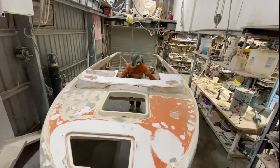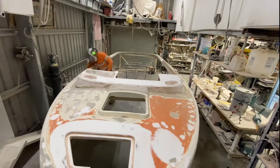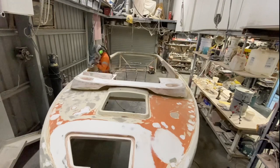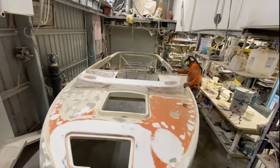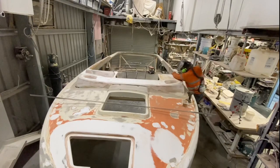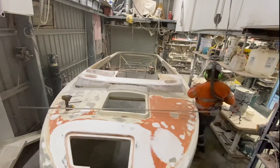It's pretty easy to get it lined up because it's such a snug fit — there's four areas where the dash leans against, and that's where the screws that I did last time. After doing the dummy fit, I found that I needed to grind down the little tabs, the little extensions that I was working on before. I have to do that a few times to get it to sit right. The old holes are still in it from where I tacked it together with screws last time I glued it, so it made it a lot easier to get the levels good. I managed to get the dash a little bit nicer — the levels on it I'm talking about.